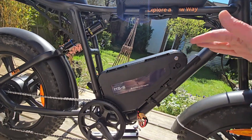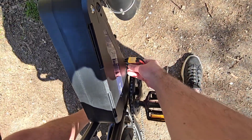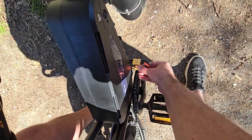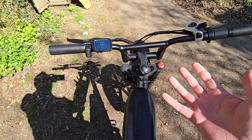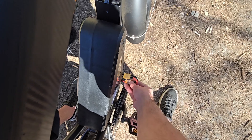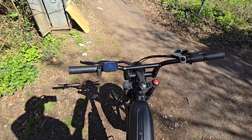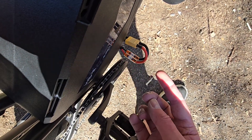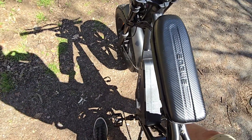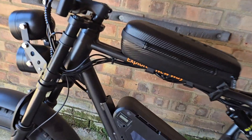I've done a few straps just to hold it on and it's looking pretty secure — I've left the connectors exposed for now just to test they don't melt or anything. I've done a few runs up this hill back and forth to see if the connectors are getting warm, and they're not at all. The max power on this bike is about 1000 watts, so realistically that's only about 20 amps at around 50 volts — we're absolutely fine. I'll just wrap them individually in insulation tape and tuck them into the frame.